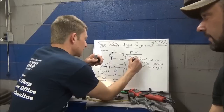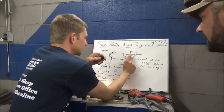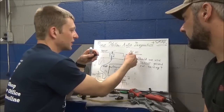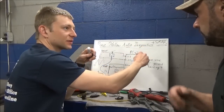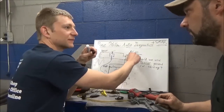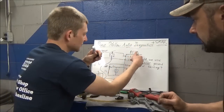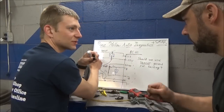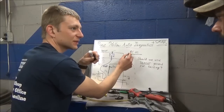Some Chryslers have a two and a half volt and three and a half volt bias on the signal. The oxygen sensor adds its own zero to one, so you get 2.5 to 3.5 in the signal - superposition, you add the voltages.